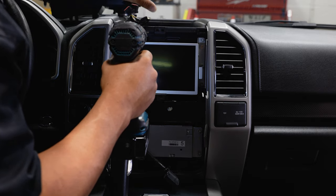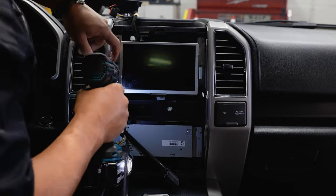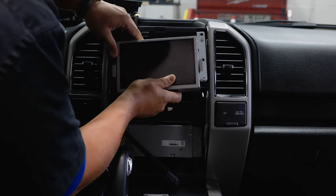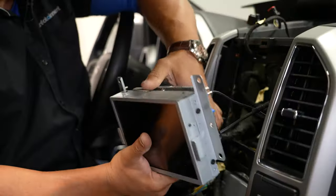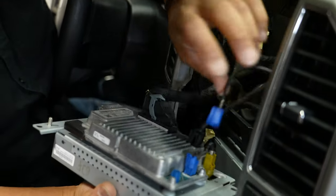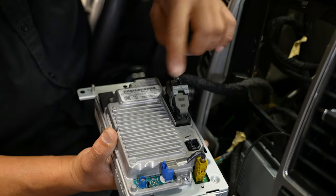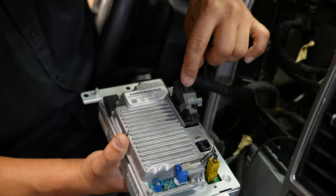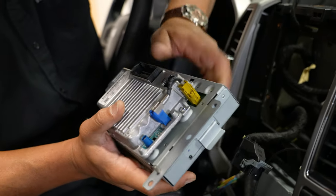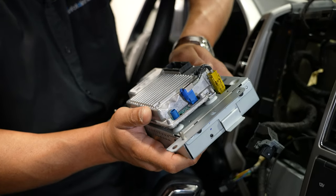This is where a little magnet may help, because if you drop one of these screws down here it might be kind of hard to fish back out. Now with our radio removed, you can see our current SYNC 3 module. We'll unplug the three plugs connected to the module. This one has a little paddle on it — you depress the center, slide the paddle to the side, and that'll push the connector right out of there. Now that we have that free, we can go to the bench and swap this out with our new module, then come back to reinstall it into the vehicle.